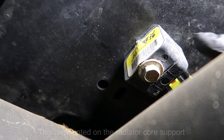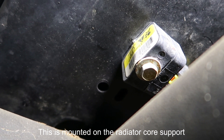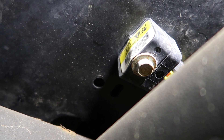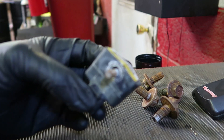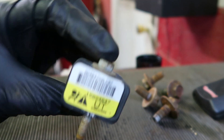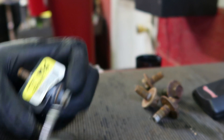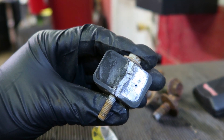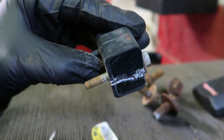You can see that hump right there in the center where the bolt is — that's telling me this thing is corroded and the corrosion got in there and actually split the sensor. I'm going to take it off so you can see what's going on. Now that I've got it off the car, you can see how corroded it is on both sides. I'll take the tape off so you can get an idea what it looks like underneath — and as I suspected, you can see it corroded all the way through and split, which actually broke the sensor.